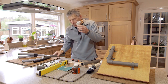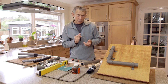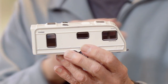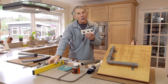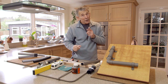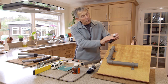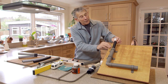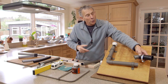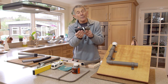So how can we build all this up? Stage one — if you're able to convert your caravan and it's not still under warranty — is to get it parked up level. That's important, and then as you use your spirit level you can make sure there's a slope all the way down on the pipe from beginning to end. The pipe runs from the sink all the way to the far end where it discharges into your waste tank, and at the discharge end you can always buy a bit of old car hose to make the connection.